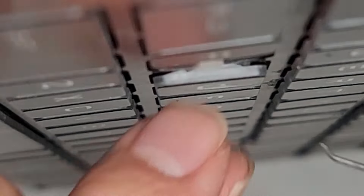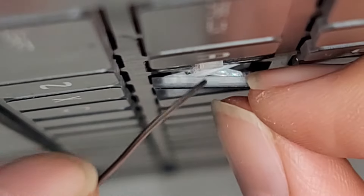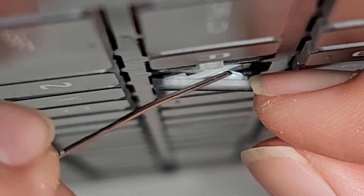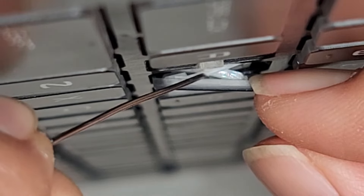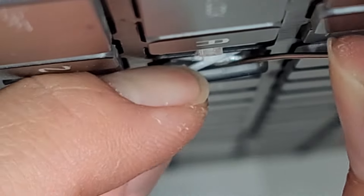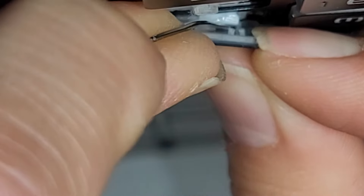We're going to do that with the next key — the letter D. The D key also had the lettering all rubbed out from playing too many games. You can actually see the cross section better now. Get the needle in the middle between the cross, then work the needle over to the side to pop the clips out. It's hard to show on camera because my hand gets in the way. Work our way to the other side and pop that clip out as well. We've got the A, S, and D keys out.